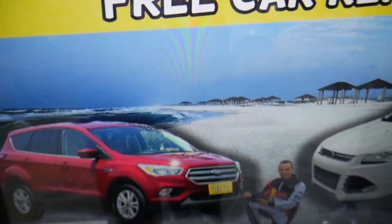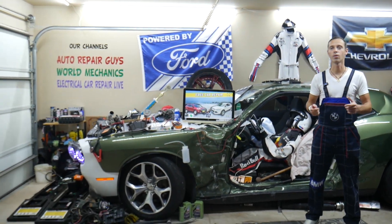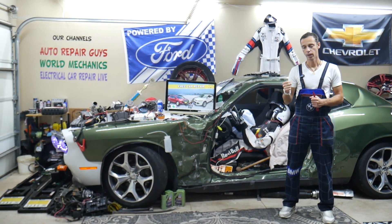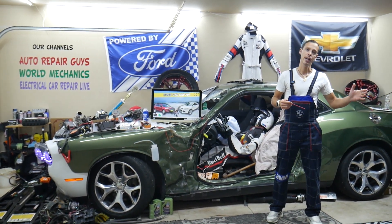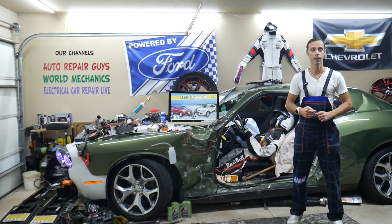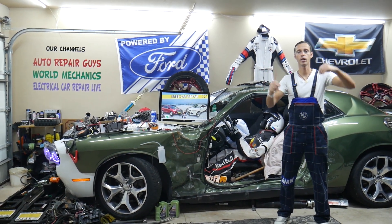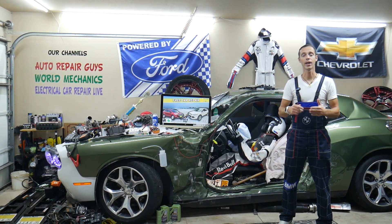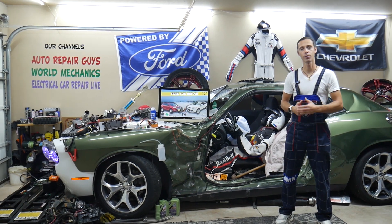All these fuses will need to be checked. Other things that can cause the rear view camera not to work: it could be a bad rear view camera — they're exposed to the elements: water, rain, dust, snow, salt. So they can fail. It could also be the switch where you put the vehicle in reverse. If the reverse backup lights do not work, the rear view camera will not work — so it could be a bad transmission switch. And in some cases, it could be where the hatch door wires go from the tailgate to the car body — from opening and closing the hatch door, they can break. Most of the time, it's a fuse or the camera itself. Hopefully the video will be helpful. Thank you for watching. See you next time.